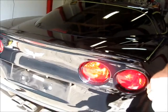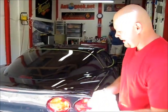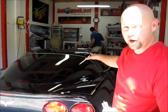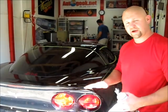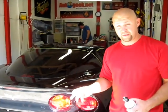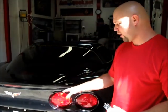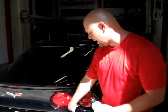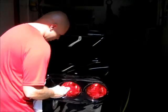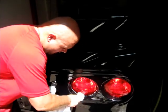I'm not going to work too hard in there because of a couple of things. As a professional detailer with experience, I know that the paint on this rear bumper is much thinner than on the rest of the car. Beyond that, this is an edge — all of the edges on any car are very thin paint, especially on Corvettes. You just want to make sure that you're careful when you're around edges and working with heavy compounds. Inside here will be less paint than on the flatter portions of the bumper. When you're working by hand, you don't have to put all your weight on it — just let the compound do all the work.